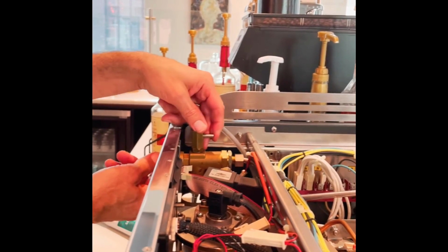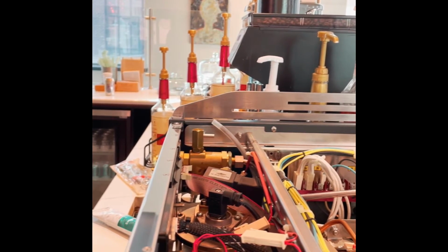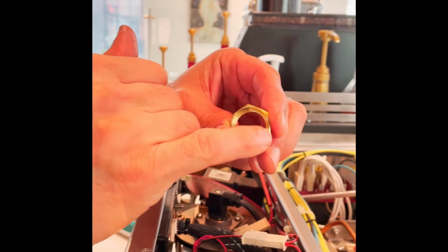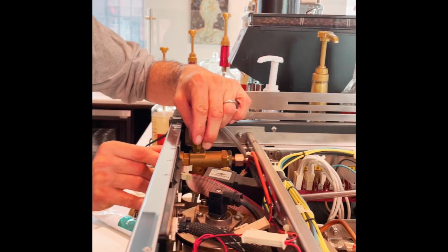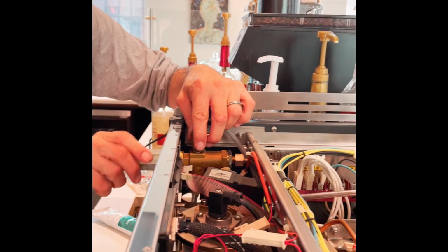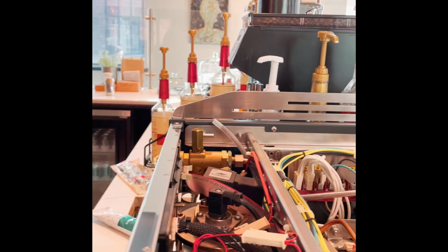I'm in the face of the frame of the unit, and I'm going to take the lock nut for the valve body, and I'm going to go ahead. Now remember, you've got a wide surface and you've got a very narrow surface. It's the narrow surface that goes to the machine. So I'm going to go ahead and just get this started and take my deep socket. I'm just finger tight right now. That's all I am. Everything is finger tight.